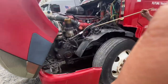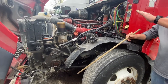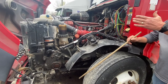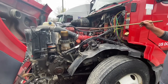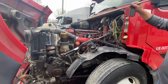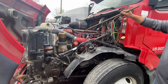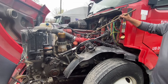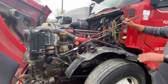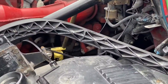You've got two options on the driver's side of the engine. You can tell the examiner you're doing an overview just like on the other side, and it's done. Or you can do the overview explicitly: checking the engine block for no excessive oil leaks, checking all hoses for no abrasion, bulges, or cuts and no signs of leaks, and looking at all wiring harnesses for frayed wires or loose wire connections. Then I'm going to check my oil level — pull it out, wipe it off, stick it back in. It should be between the add and the full marks.